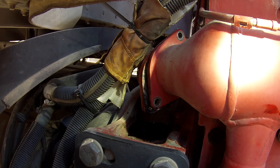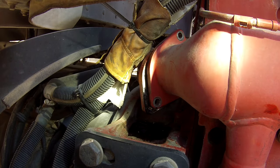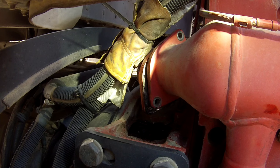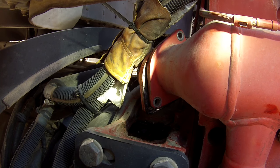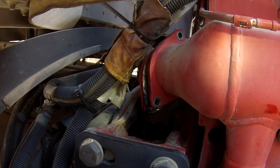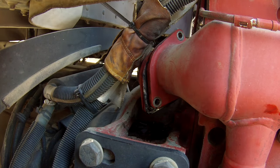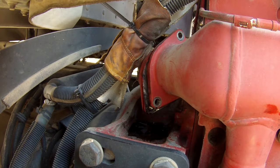Usually, depending on how long it's been, you might need to take the DPF filter off. When I pulled this one off, it had red coloring in the DPF filter, meaning the coolant got in there already. But it looks like it didn't damage the filter yet, though it sure did plug it up. This is just one of my videos showing you how to properly check an EGR cooler for leaking. If you have any other questions, let me know — see you next time.